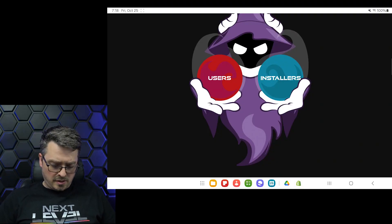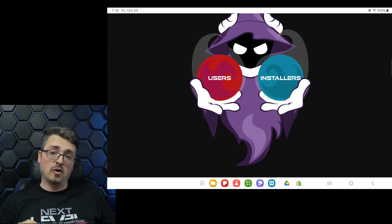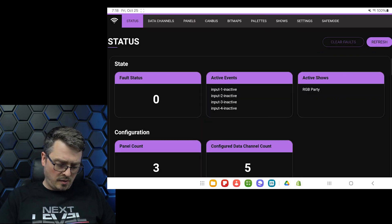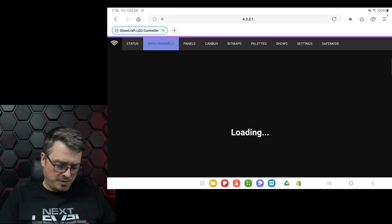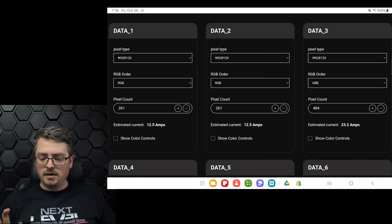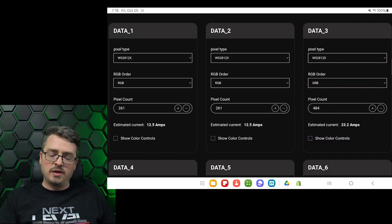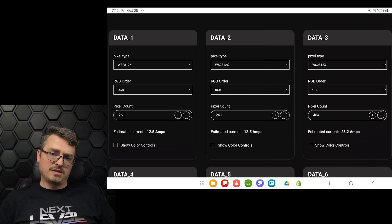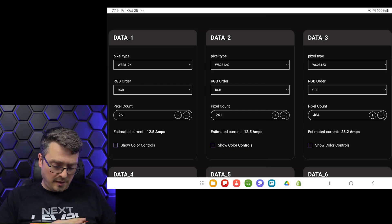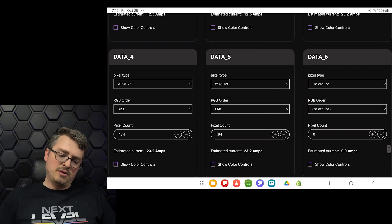We're going to go back to our tablet and connect to your Wi-Fi. The password is 'current LA', all lowercase. We're going to choose Installers and the basic screen will pop up. We're going to jump right over to your data channels — this is where you can set up your extra panels. Keep in mind which data channel you're plugged into for each panel and the orientation of each. In this case, data one and data two are for the actual taillights for the S2000, so we're not going to touch those. We're going to work with data three, four, and five, which are the three I'm using for these panels.